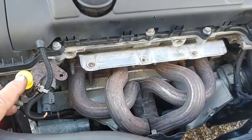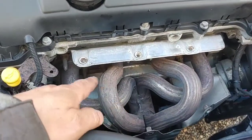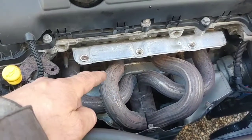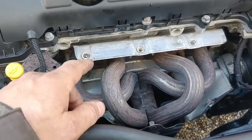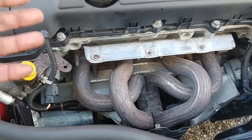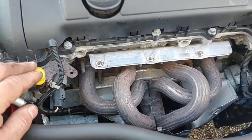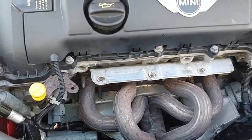One of the things I'll check for is water in the crankcase — I'll just check the oil. That could only have happened if water flowed up the exhaust manifold to an open exhaust valve, down into the cylinder, and sat there long enough to drain past the rings — very, very unlikely. But it's a safety check you should do.